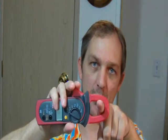I've got another little tester here. This is a voltmeter with a clamp on it. You just clamp it around your alternator wire or your starter cable and you can measure the current. One thing I've run into in the past is that sometimes if your battery is weak and keeps going dead it may be the starter pulling too many amps. I had one of my service trucks with two big truck batteries and it sucked them dead before it would start. I stuck a meter on it and it pulled 600 amps — typically that starter wouldn't pull more than 150 to 200. Basically it was a bad starter motor.